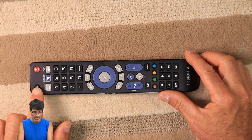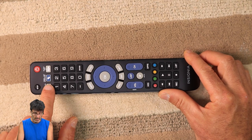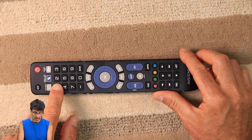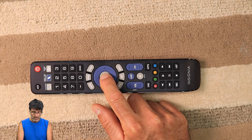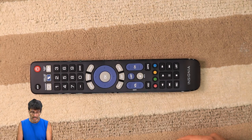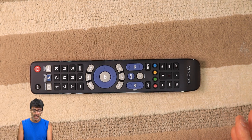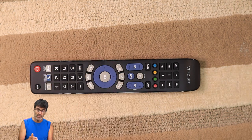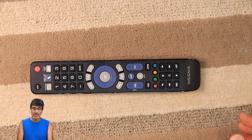So we've turned on the device, press and hold Setup. In this case we're working on a TV — remember 0, 1, 2 — we're pressing 1. Now press the OK button. It's flashing, so you just have to keep pressing and remember to keep it pointed at your TV the whole time. The TV turned off, we got two flashes — great. Turn it back on and test for functionality. If yes, you're done. If not, you can try again and wait for the second code that activates your TV, or if you're just missing one or two features, you can teach the remote using the learning function.